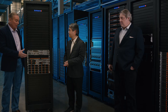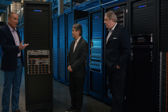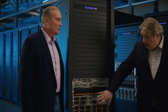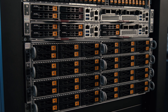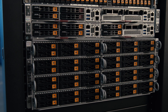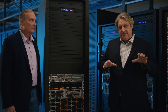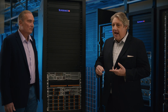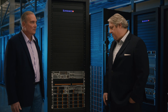We use the building block approach, which is really key for us because it allows Supermicro to get these products to market much more quickly than a lot of our competitors. On the Fat Twin config, we've got six drive bays with 2.5-inch NVMe SSDs. We also have the 4U 4-node storage flavor, which has up to six 3.5-inch spindle drives plus two in the back for a total of eight. That's for customers who want to standardize on one platform throughout their data center infrastructure. We're seeing it used in EDA applications and in big data centers with a lot of horizontal communication. The PUE benefits of having one single processor that's air-cooled makes for a very compelling use case.